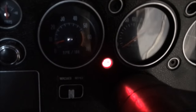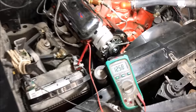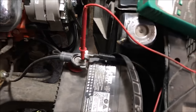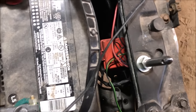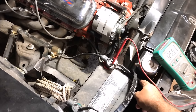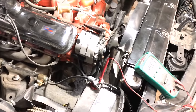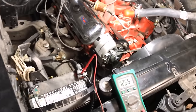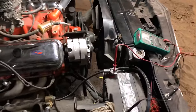With the one-wire you're going to use a volt meter. Ignition on - let's see what RPM this kicks in at. It says 1200 RPM, but it kicked in already around 600. Everything works out fine - it actually does look a lot better. We can barely tell it has a number 4 wire in there. We've got our junction block in case we want to run accessories like our amp off of it. The most important thing is the wires - if you have undersized wires they're going to get hot, the insulation will get soft and melt off, causing all kinds of short circuiting problems. Protect your wires, run oversized if you can and everything will work out. I've been working on this project for over two weeks - if you enjoyed the video, please like and subscribe.